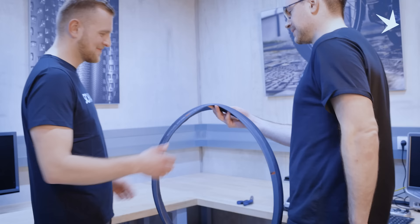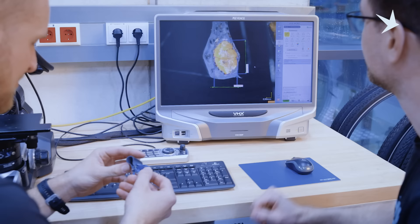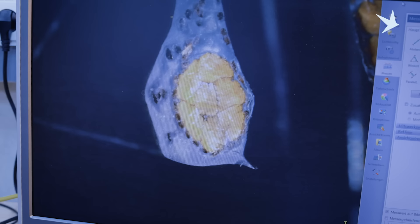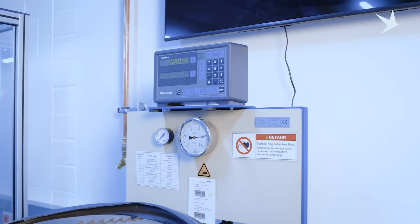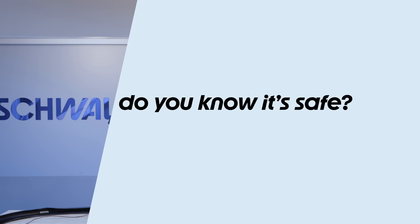The special thing about it is that it doesn't stretch at all under pressure. We have really high max pressures that we test here in the laboratory, and we also analyze how the shape and the windings influence the derailing safety of our tires. Under the microscope you will see that we go through different iterations of how many windings we use in the bead core, what material, and the size is extremely important. The circumference of the tire after being produced is a really crucial element, and we use a lot of time and money to ensure product safety with our road tubeless tires.